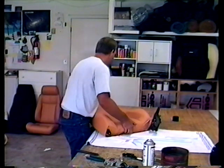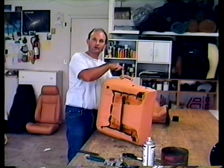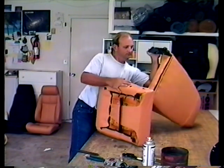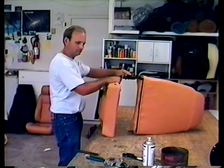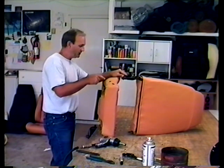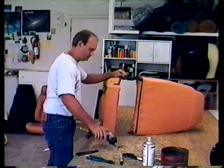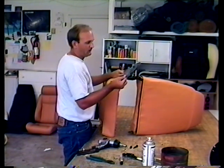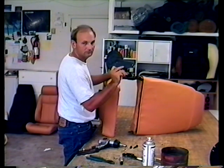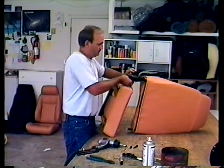Now you need to put the two pieces back together. It's easiest to start with the bolt sides — attach these two parts together, then the tracks. Remove these bolts, but it's a very good idea to put them in and then cut around them so you don't end up cutting a hole someplace that shows. Don't forget that plastic upholstery protector for the hinge — it has markings on it, the L faces the upholstery. Slide that in there; it has two holes that match these two holes.